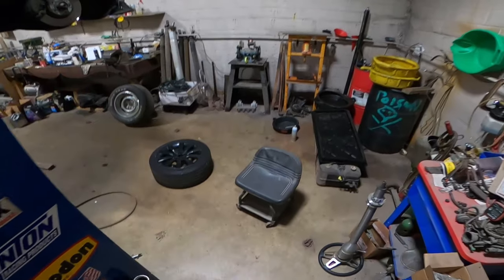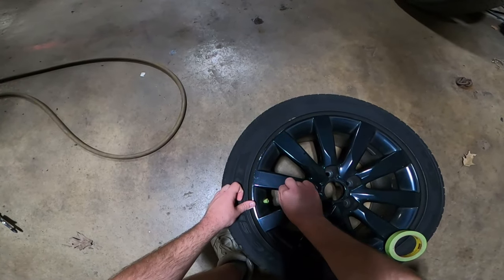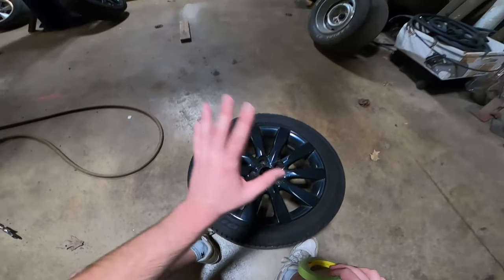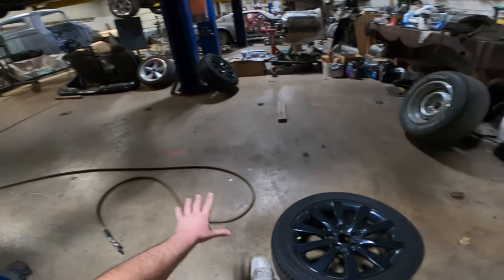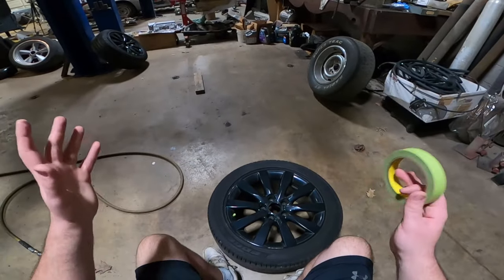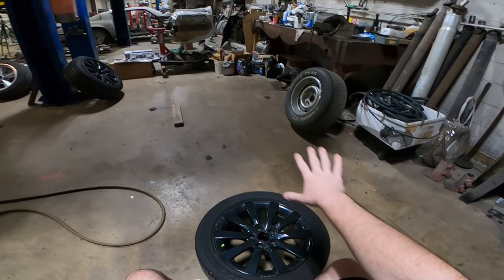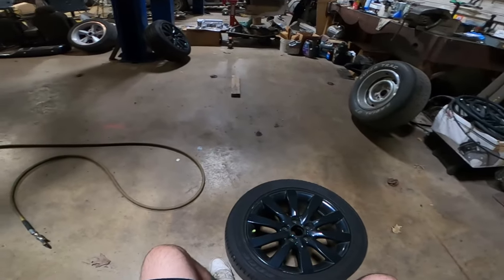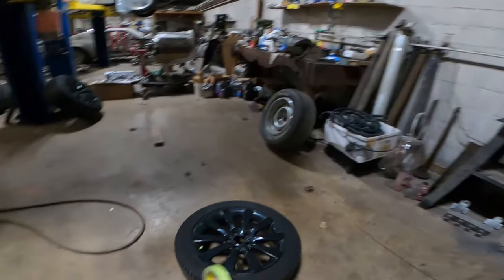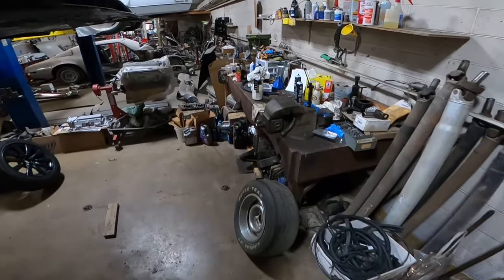First off, I'm gonna mask off my valve stem. These are not the best wheels. Before I even scuffed any of these, I degreased all of them and scrubbed them very thoroughly - degreased them like twice each. Then before I scuffed them, I used that pre-cleaner right over there on the bench. I'm gonna use that to clean them off one final time, scuff them, wheel them over, and then clean them off one more time before paint. When you're painting, number one thing - you want this as clean as humanly possible.